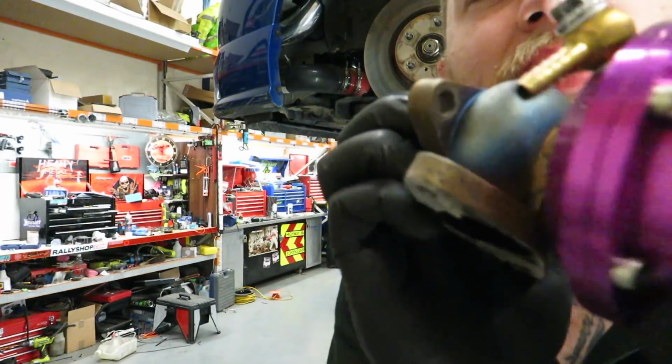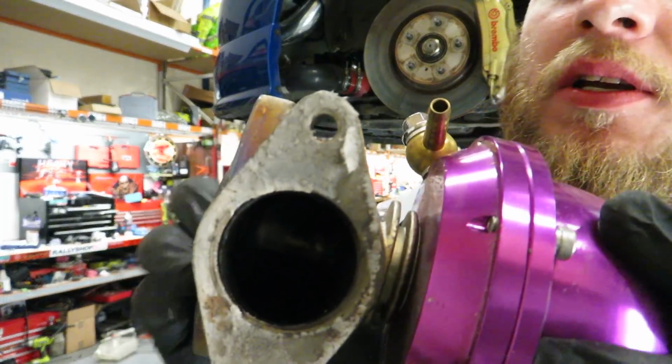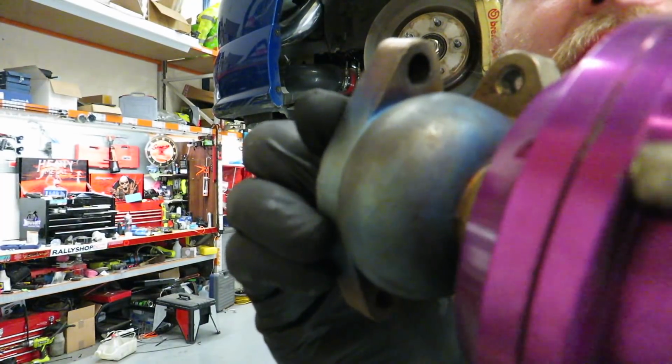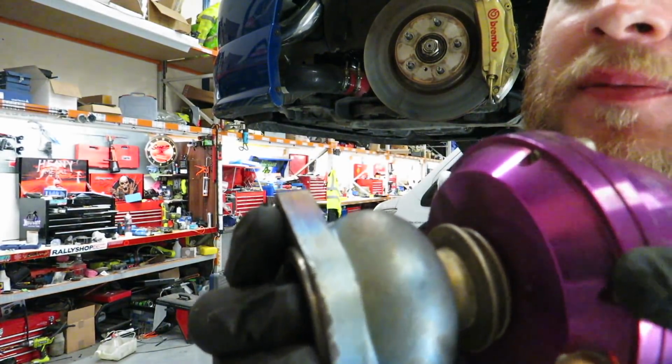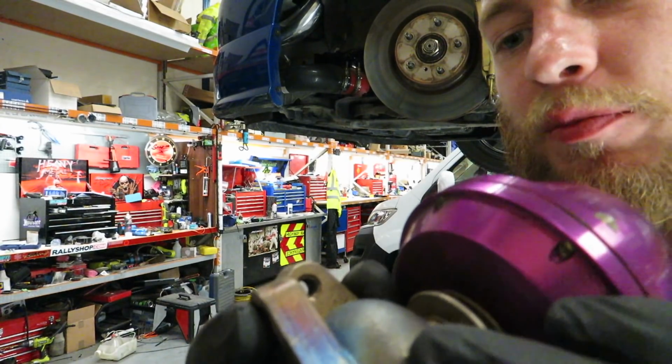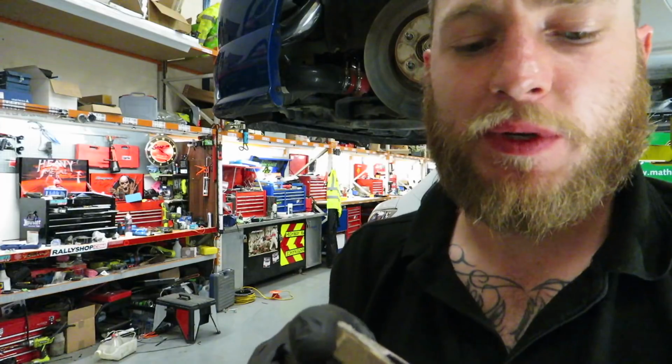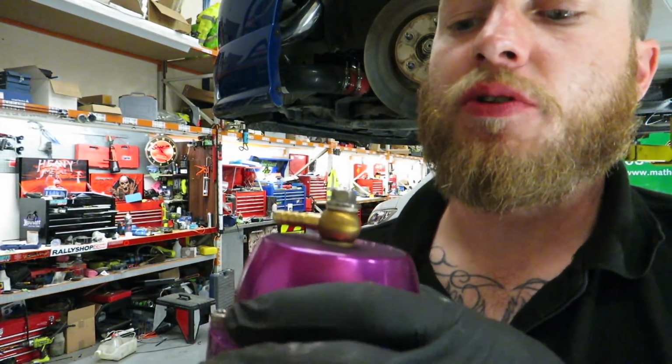And they've got 10mm heads, 8mm thread, titanium. But they've got a 15mm collar on, so I might have to, if you can see it that way, I don't think I'll get 15mm in there. So I'll probably have to grind them down a tiny bit. See how my grind wheel takes titanium. But I'm going to unscrew this anyway, get the spring out, get my new spring put in, and then we should be ready to hopefully get to Chris before Jackfest, so we can remap it, get it all done again, and just play around with some pressures, and we should be laughing.